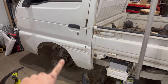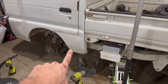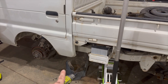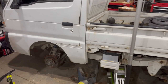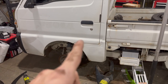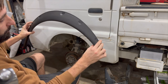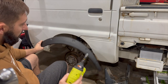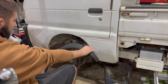Looking at the flare, I kind of put it up there - I want to maybe keep the mud flap, so there's a little dirt there I'm going to use as a mark and put the flare just outside of that. I'll be able to trim the mud flap to put it back so mud doesn't shoot up on the battery. It kind of makes it look lower too, which is cool. I'm going to start screwing them in - I drilled all these with a center point drill bit to get pretty close to center, then I'll start with some self-tappers and once it's all on we can switch it out for nicer hardware.